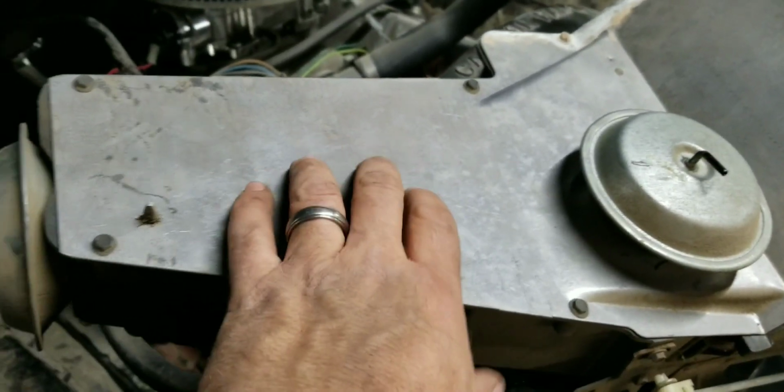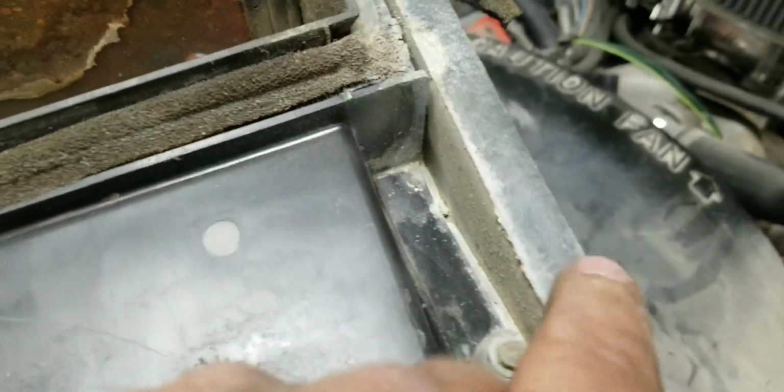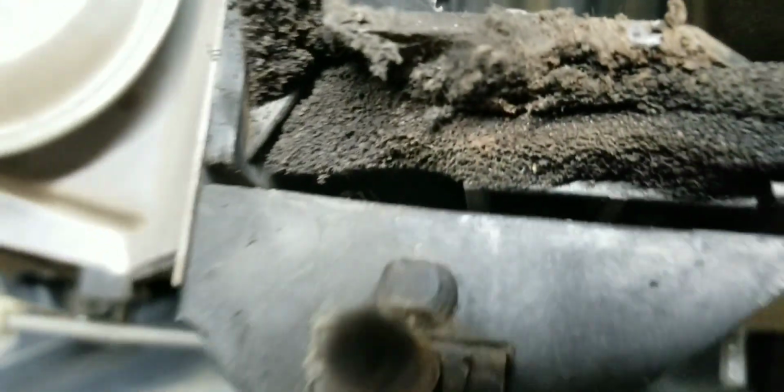I will be taking this completely apart, so I'll be taking this metal off, this metal piece here. I'm going to clean all this out. As you can tell, if you look, pretty dingy, grungy. Let's see if we can pull this a little bit. And there's the heater core. So to get that out, it looks like 9/32 there. You have another 9/32 there. Let's see. Yep, you can see it. One down in there. And there should be another one. Yep, right down in there.